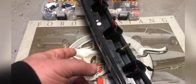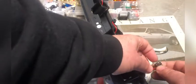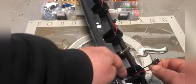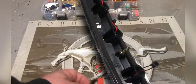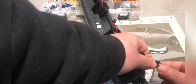Now I'm going to check and see if the polarity on these are wired as advertised, because there's a possibility that they could have switched the wires inside and they may not be wired up correctly, because you really don't want to put 12 volts on these LEDs if you don't have to.